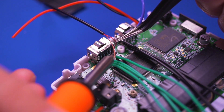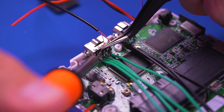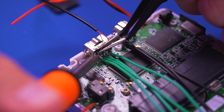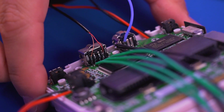Next, let's connect the wireless charging module. Solder the positive red wire to pin 2 and the negative copper-colored wire to pin 6. I highly recommend you check out my wireless charging mod video for a much more detailed tutorial on how to install this — link is in the description. Also, ignore the green wires. These wires were installed for the 3.5mm jack before Kyle and I realized we ordered the wrong part. I removed these wires later off camera.